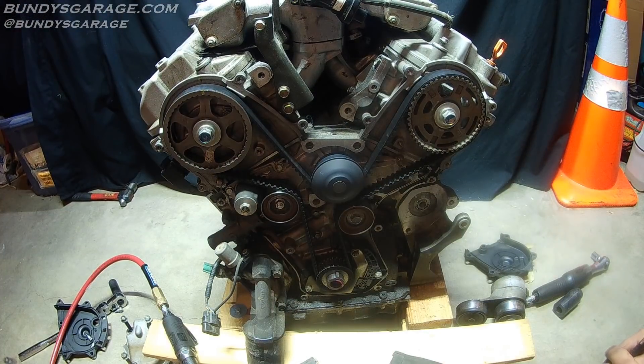This is how you gain access to the top cover and the timing belt on a J Series Honda V6. Had to remove this idler right here — there's a 14mm bolt in the center and a 12mm right there on the bottom. This is your front cam, this is your back cam, this is your water pump right inside there. Obviously this is your timing belt, this is your idler pulley, this is your tensioner idler pulley, right there is your tensioner, there's your crank, there's your keyway. Right here are the marks I was talking about — right where the dot is is your number one. You can always grab a 19mm wrench and move it just a hair counterclockwise or clockwise depending on which way you need to go to line it up.